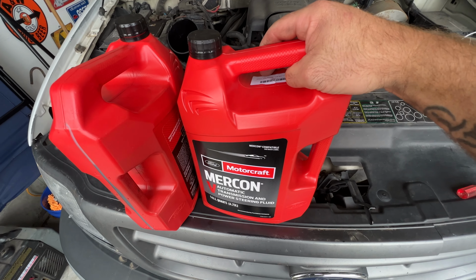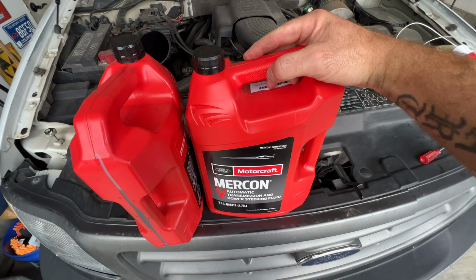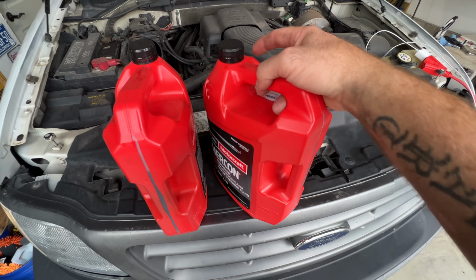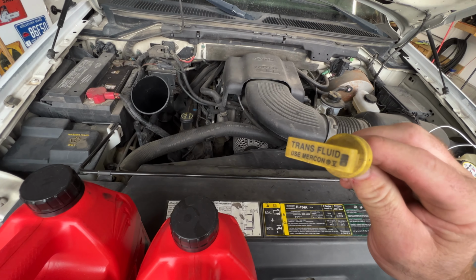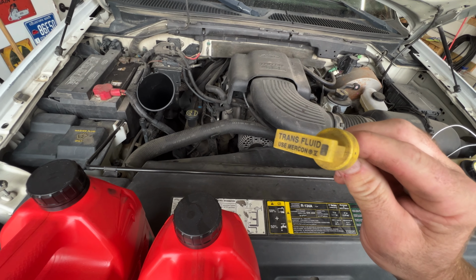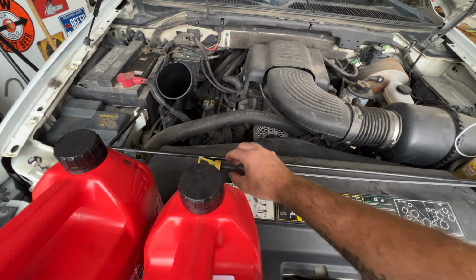This is gonna be stuff I'm putting in. It's Motorcraft Mercon 5, which I got off Amazon. I'll put a link in the description for it. And you can also check your dipstick here just to make sure you're buying the right stuff. You can see that says use Mercon 5, or you can check your owner's manual as well.